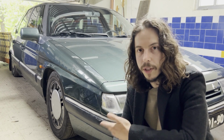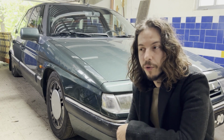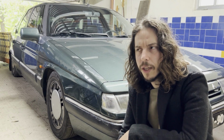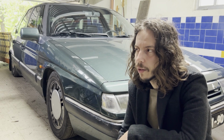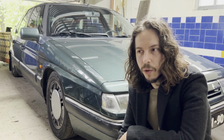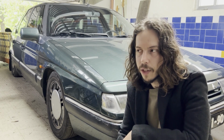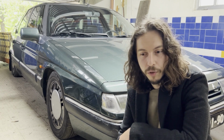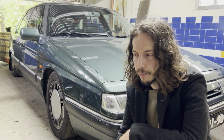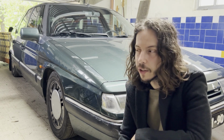This video will be about the XM. I've replaced the inner and outer tie rods, and I've also removed the sump because this car, since that trip to the Netherlands, has a low oil pressure warning. It's been getting worse over time. I thought bits of the dipstick could be in the sump and also something else that could block the pickup tube that feeds oil to the engine.